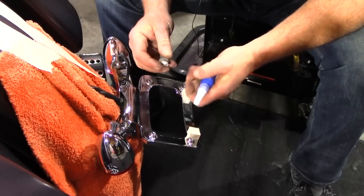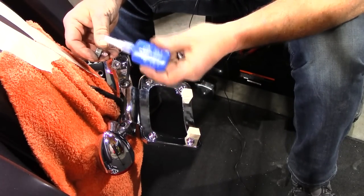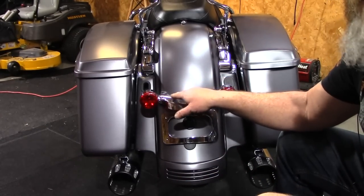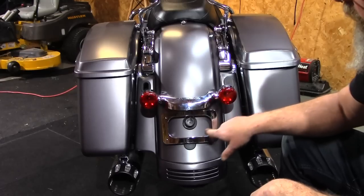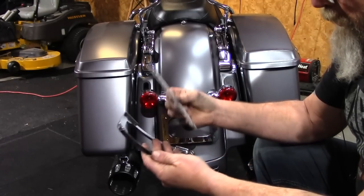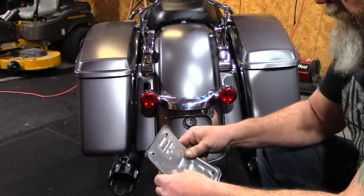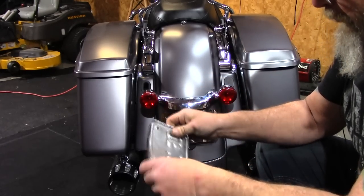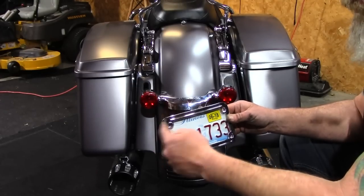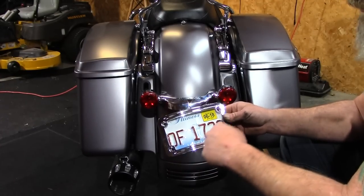Activate the sticky by taking your thumbnail and running it back and forth before peeling the layer off — that activates the glue. Those foam pads are stuck on there real good. Now flip it back over, add just a little bit of blue loctite on the bolts, get them back in, and then put the plate in. When fitting the curved plate, put one side in and push down in the middle so it bends and forms to the frame. Don't torque one screw all the way down expecting the others to line up — get all four started slightly, then torque them down in a circle.